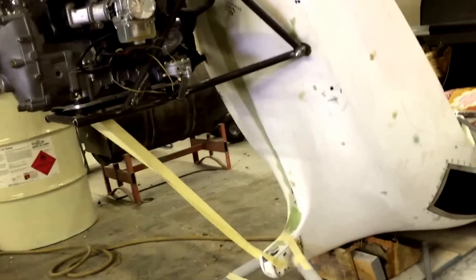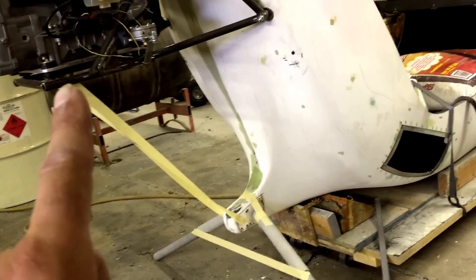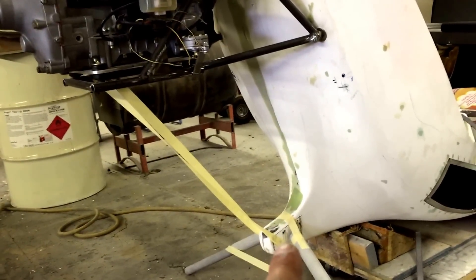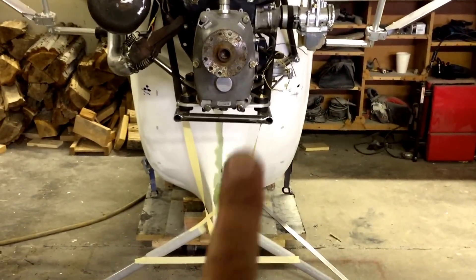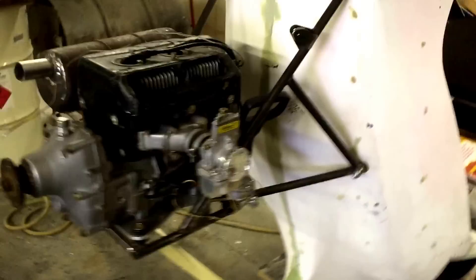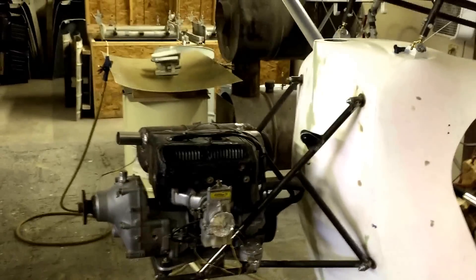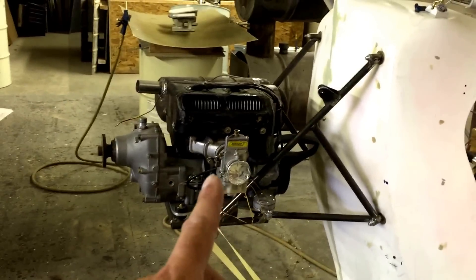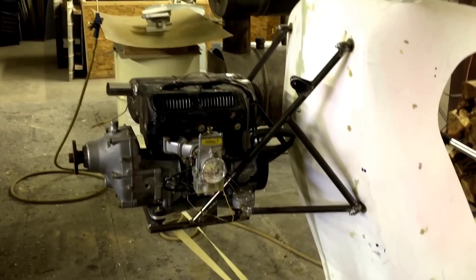These tubes right here are going to be the same three-quarter tube, and they just get bolted up to the outside edge of the bottom of this engine mount, going down to a bolt right there on a rod end. That just gives this motor mount more strength right here — although you don't really need it for this engine because the static weight is not even pulling that down. I could probably put 40 to 50 more pounds up there, even without those — probably 100. I haven't even tested the static load because I don't have my wheels yet.